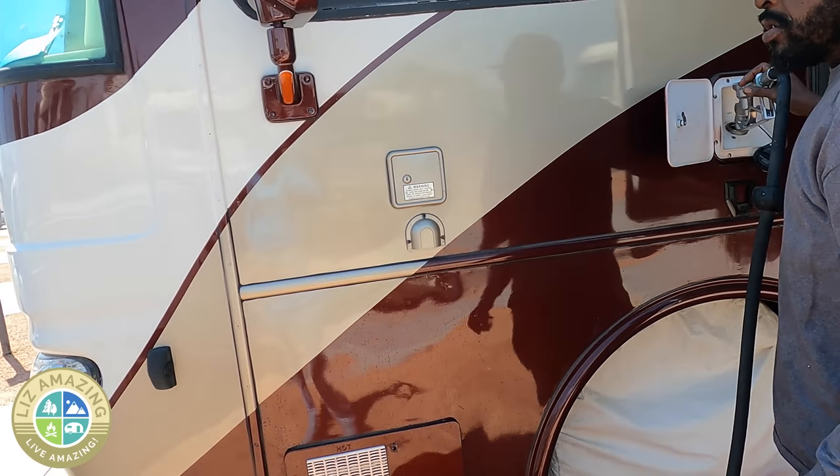I asked how they would fix it, because I certainly couldn't move my RV. They said they have a big 275-gallon tank. My fuel tank is 90 gallons and full — 13 gallons of that are water. They said no problem: they'd drain it, bring 40 gallons of diesel, put a few gallons in to rinse it out, drain that too, then fill it with the rest of the 40 gallons so I could drive to a fuel station and fill up. I said come on out — they'd be here in a couple of hours.